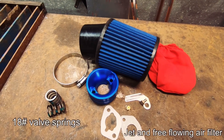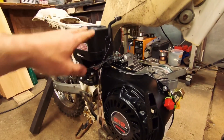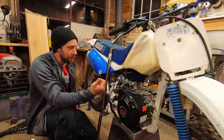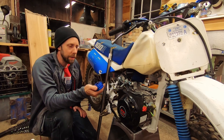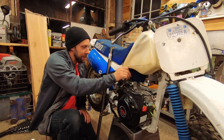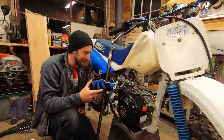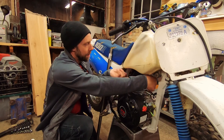So the most awkward thing of the swap so far was the air box — I mentioned that in the first video. It's kind of off to the side, kind of in your way with your leg. There's not much I can do because the intake port is right here and the carb is right here. But for this swap with the stage one kit — air filter, jet — this is just not going to be practical. No matter what you do, you can't have your leg right there. So I'm going to try to mount the air filter up on top.